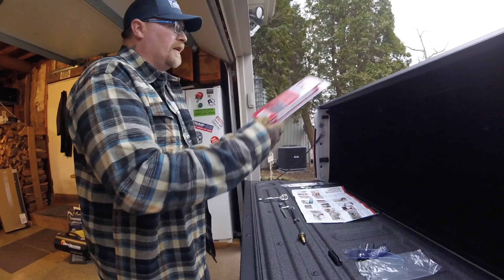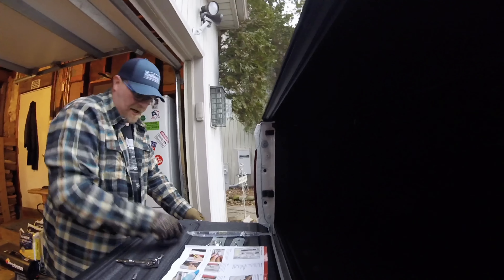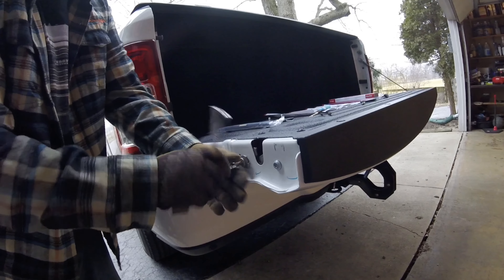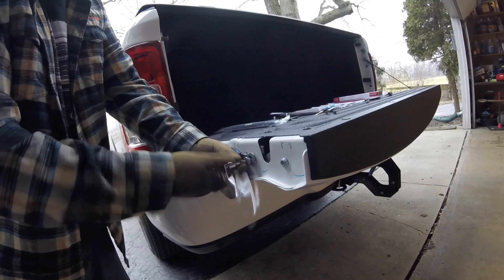Really easy to install. First thing you've got to do is pop your cable off on your tailgate because this has got to come out - I pull the whole cable off. You don't really need to, but there's a tab. They tell you to beat this tab down because it's a limiter - it only lets your cable move so much. Once this is on there, the shock itself needs this cable to be able to move freely. This is the actual locking side and that's the side you've got to beat flat once you get it out.